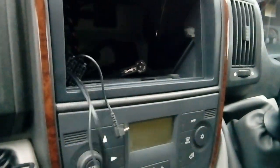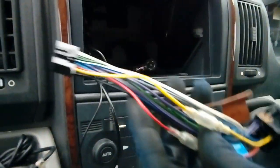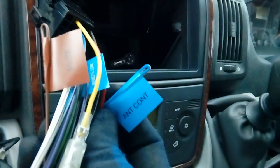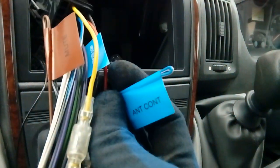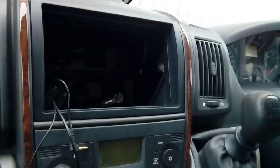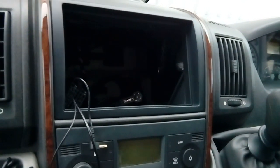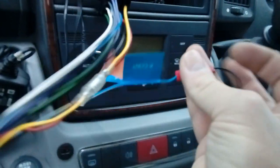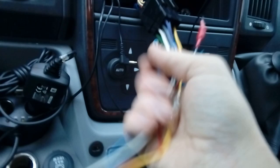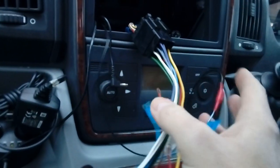The DAB radio's aerial needs power. We've got the DAB aerial connector, and there's also a wire with a sprig on it. This connects to the blue wire on the loom that comes with the new radio — labelled 'antenna control,' originally used for electric aerials. We can use this to power the DAB aerial cable. Join the two together with bullet connectors or solder — bullet connectors are preferable so you can unplug it in the future. Tape over the connection and tape the loom together to keep it neat so no wires get trapped when you push the radio in.